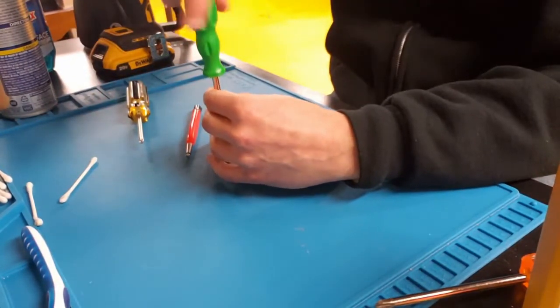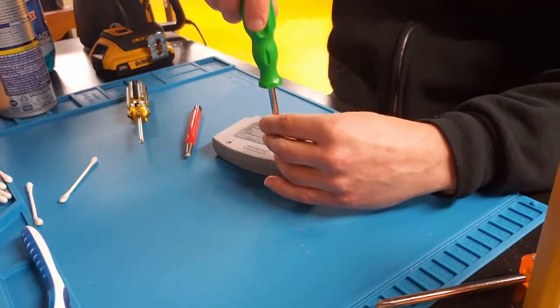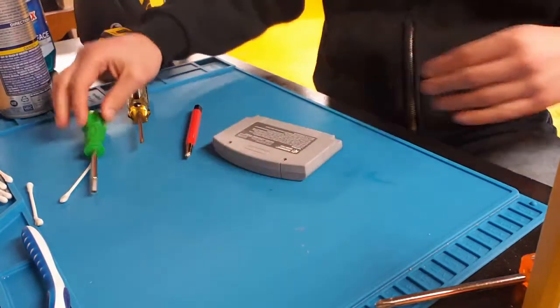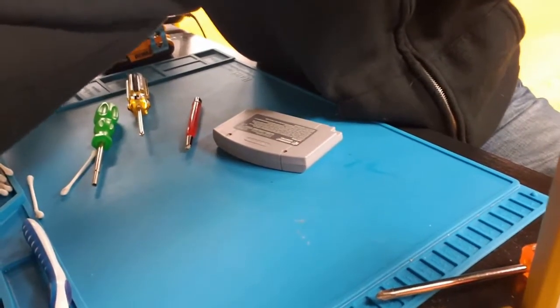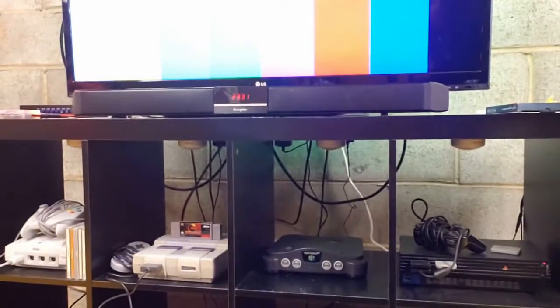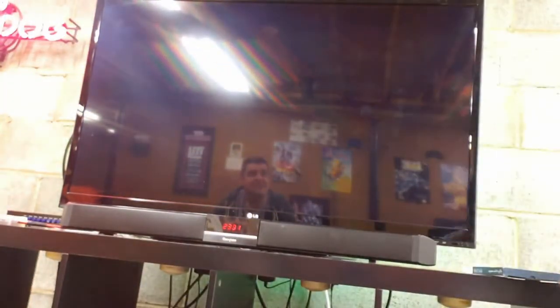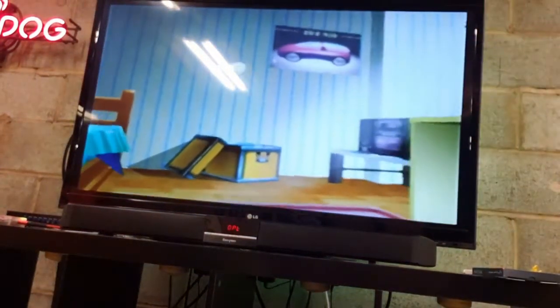Using your game bits — there are two different sizes: 4.5mm and 3.8mm. We'll put a link in the description to your game bits. These will work on multiple carts, and if you're going to be cleaning carts you're going to need these. Now that that's done, it's time to test the game out. We'll head over to the N64, put this game in, and see what happens. It fires right up — that's what we'd like to see. It's time to play a little bit of Super Smash Bros.